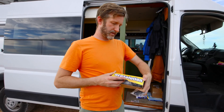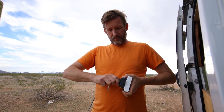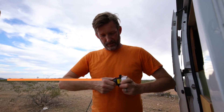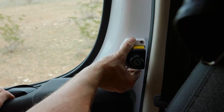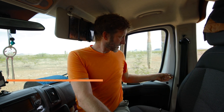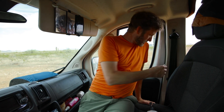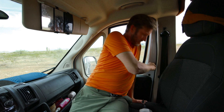Let's take a look at the driver and passenger door locks — these go inside the doors, not outside like the rear lock. You push them in and turn — they're a completely different design than the exterior locks. When installing these, make sure you have clearance in the unlocked position so you can actually open and close your door. I'm using a spring-loaded metal punch tool to mark my spots on the metal — when your drill bit goes in, it has a little groove to follow so the bit doesn't drift.